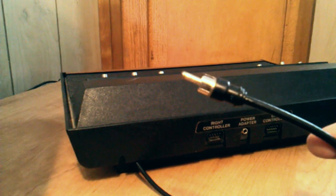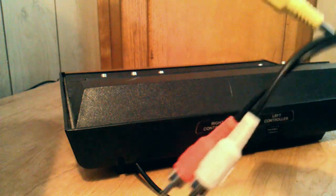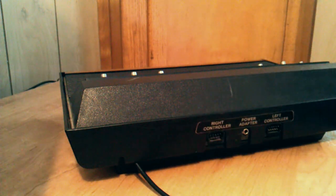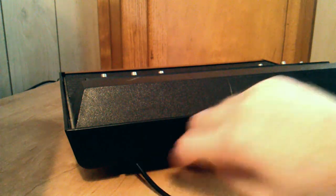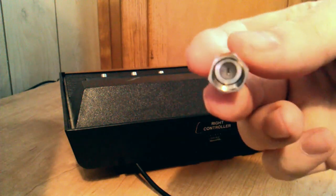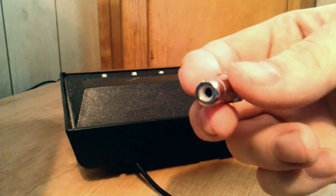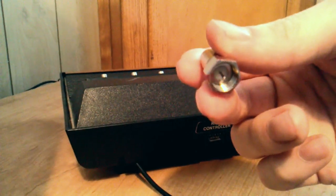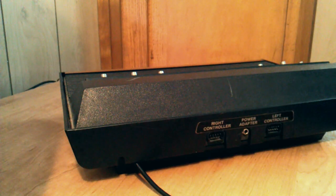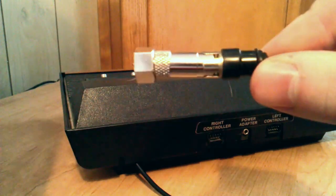As for video, the Atari 2600 uses a standard RCA cable. It doesn't matter what color they are — they all work the same. Mine plugs in within the system; some models have it on the outside. Now you can't just plug the RCA cable into the back of your TV's video input. You need to get a little adapter — you can get it at Radio Shack for like $3. Ask for a female RCA to male coax adapter. It simply plugs into the RCA cable like this.